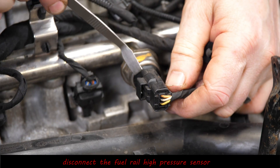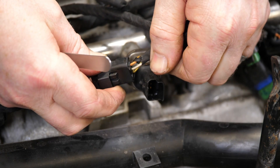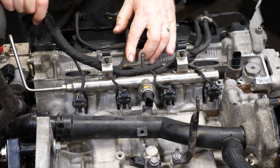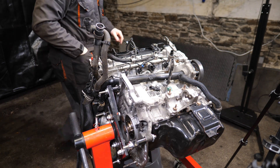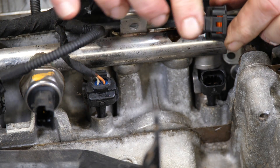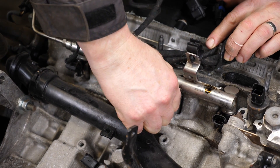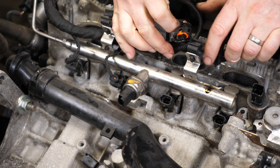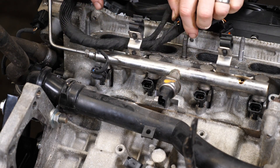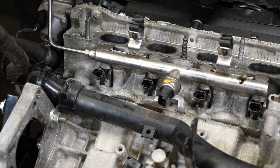Now to remove the electrical connector from the fuel rail high pressure sensor — that one has three wires on it. We've also got the four connectors that go to the actual injectors themselves, those are just a squeeze and pull off. All the colours are actually the same — orange and white. It'll be quite interesting to see inside this engine; I'm pretty sure we've got pistons and valves that hit each other, as the vacuum pump seized and pushed the timing out — that's what I'm predicting.